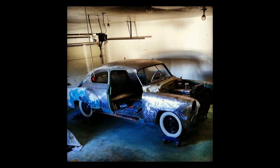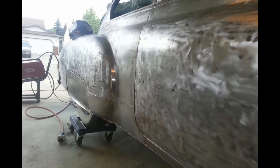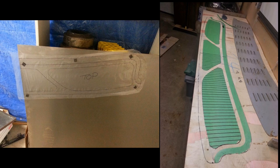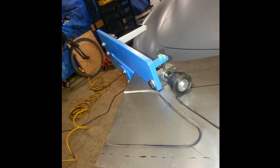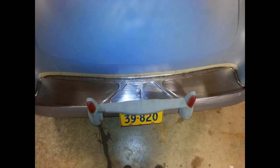Very shortly after this, the car was stripped down, and a bunch of patch panels and some metal finishing were done on the body, as well as some fender skirts that had a lip on them. The splash pan was also redone, transferred into a plastic pattern, and bead rolled out so that it matched the length of the quarters when they were redone.